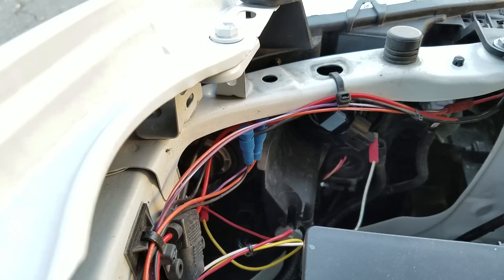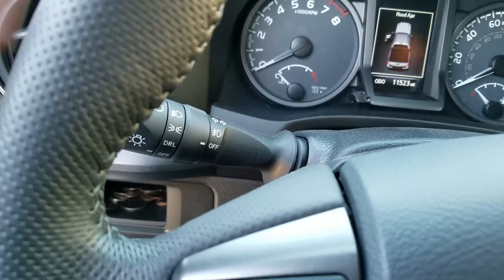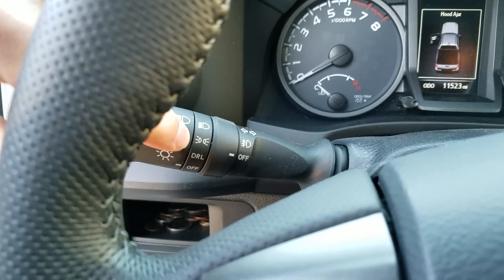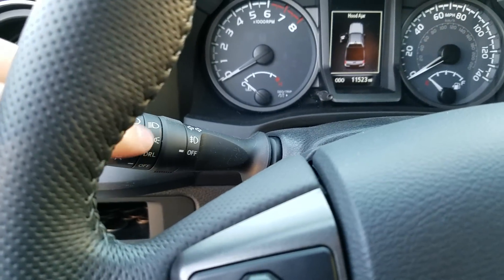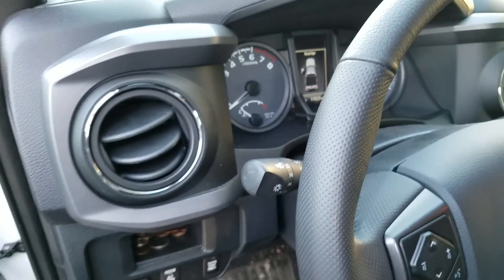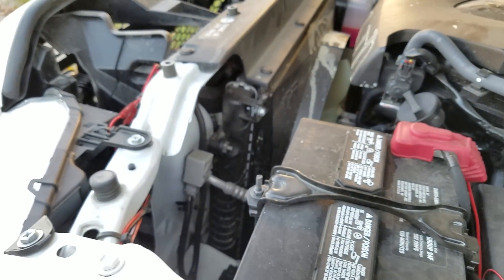Basically, if I turn on the daytime running lamps — there are three settings on the dash column: normal daytime running lamps, then the all-around running lights, and low beam, and of course push it forward for high beam or fog lamps. I have mine set up so if I turn on the all-around running lamps, the LEDs go to about a 10 or 20% setting. If I turn on the normal low beams, I get 40%. If I then go to high, they go on full power. So I don't have any other switches — it senses what setting is on my column switch, which kept it pretty clean.